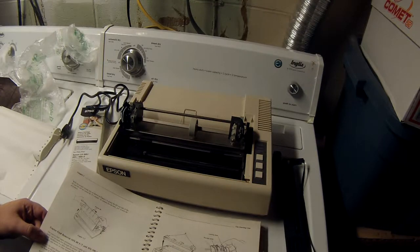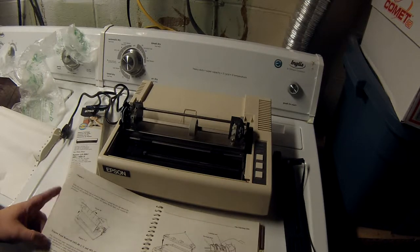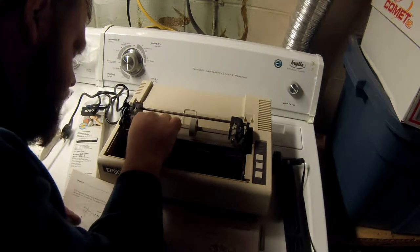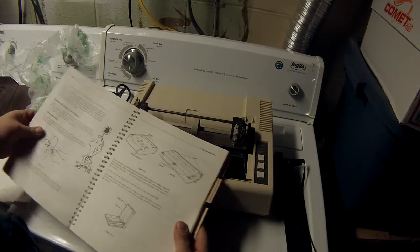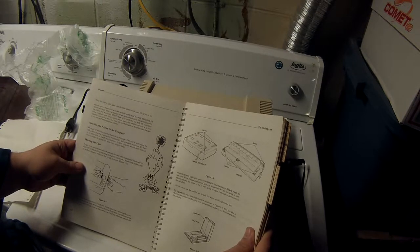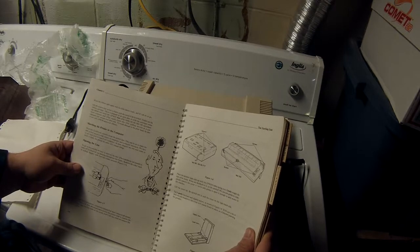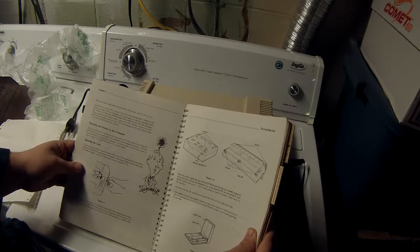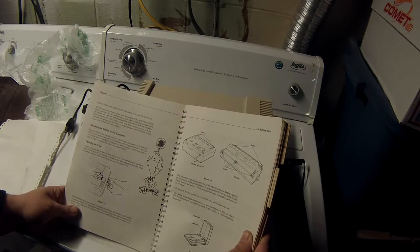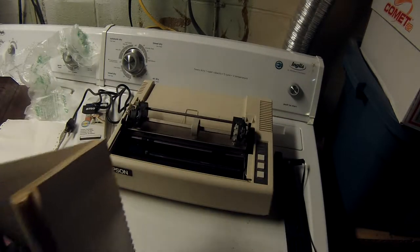Using a pencil, lift the ribbon into the slot in front of the print head. With a little practice, we can do it one quick operation. We are in. Wind the ribbon tight again with a little plastic knob and it's all set to go. MX-80 owners may notice a sticker with the words exchange times on the ribbon cartridge. This is a remnant of an early plan to refill the cartridges when the ribbon was worn out. Epson does offer refills for the MX-100. Well, I guess we don't have that here.